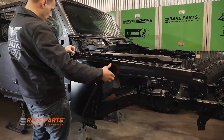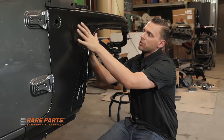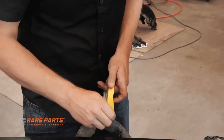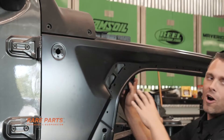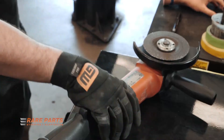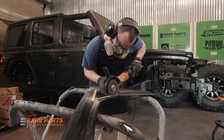This is our replacement front fender on our JL project. It's got this nice little side indentation for a fake vent from the factory — we're gonna utilize that for our side exhaust. We're gonna make it look like this indentation was here for our exhaust coming off the engine, so we're gonna trim this up, trim the area behind it, notch the firewall, and have our exhaust coming right through the fender.